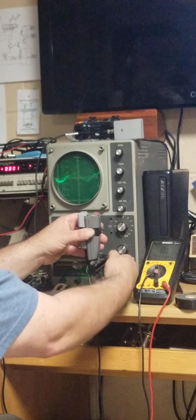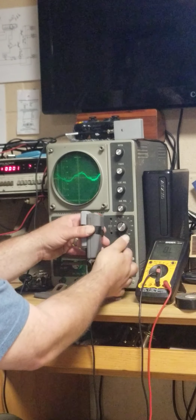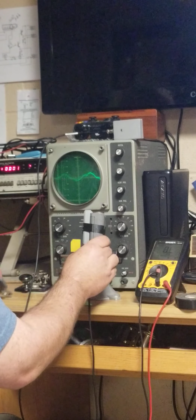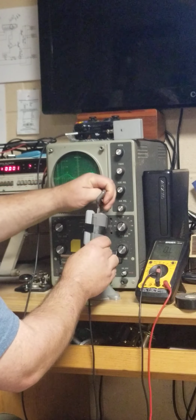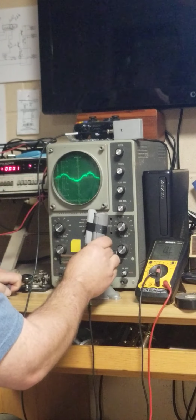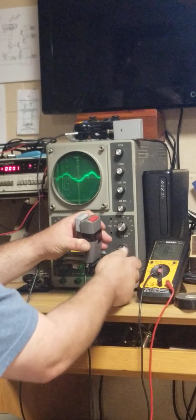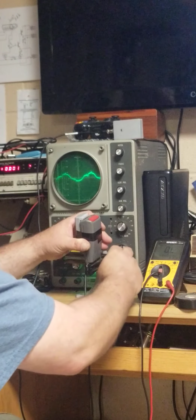Alrighty. Next, we're going to adjust this sensor so that it ignores any metal inside this housing and only reads the additional mass of the seatbelt tab coming in. So it reads this initial mass. Okay. Quick, and clamp this back in our clamp, just so I can work with it here.